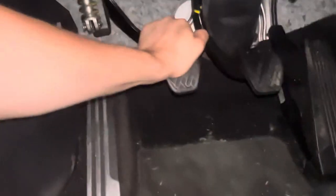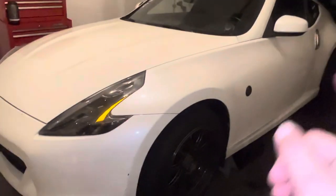This is what your clutch should look like - it goes down and back up by itself. It's good, it's firm, it's the way it should be. We already closed the bleed nipple, we already filled the reservoir back up. I'll take it for a test run.